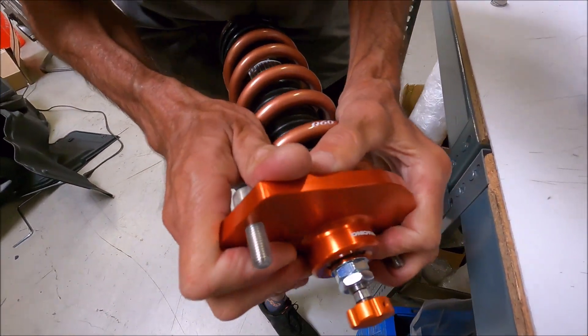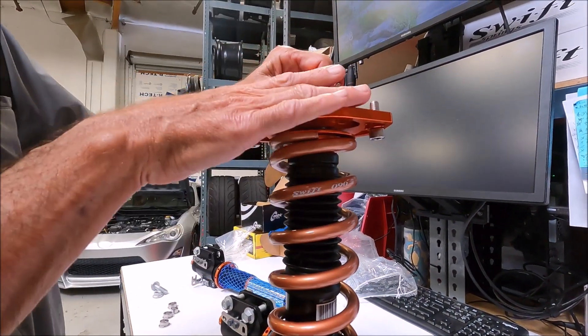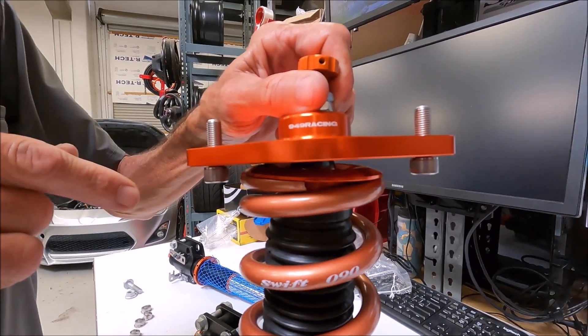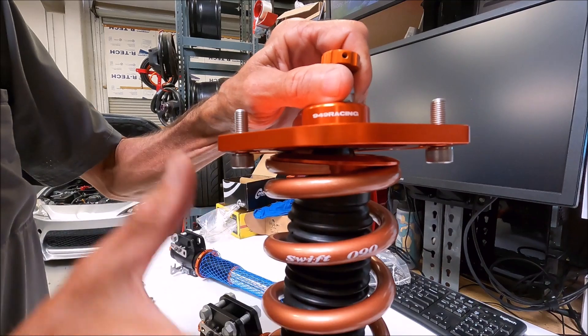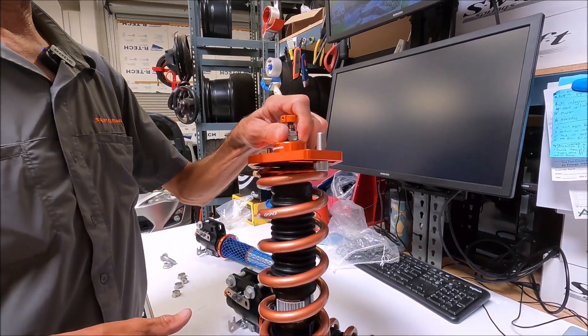You can see this is what a coaxial perch does. The spring perch is independent from the body mount. We have a separate video — it'll be linked in the video description — of why you want a coaxial perch, and why you don't want the spring pressing up against the mount. That's a complex subject; we have a separate video on that.